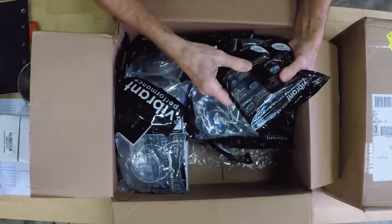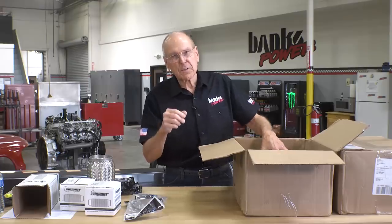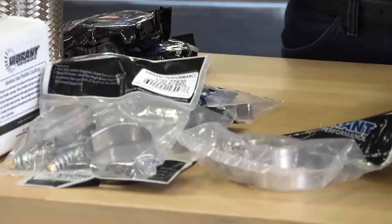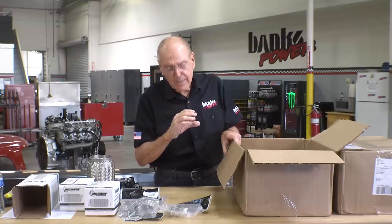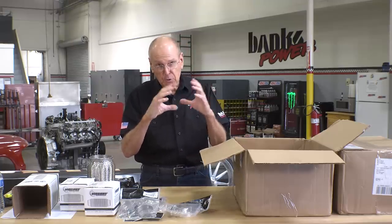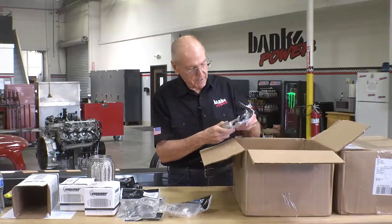These HD clamps are really special. Spring-loaded clamps. It's pretty apparent their goal is to save fabricators a ton of time. The beauty of spring-loaded clamps is that as the hose you're clamping takes what's called a cold set — if you're running boost air or whatever, it heat cycles, and after a while it takes a set and the clamp becomes somewhat looser because the hose material has taken this set and is now a bit smaller due to the pressure of the clamp. The spring-loaded clamp follows that and maintains pressure without you coming back with your screwdriver or socket and tightening the clamps periodically. It's almost like you put it together and forget it.